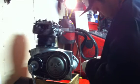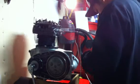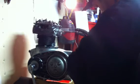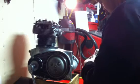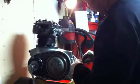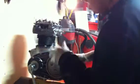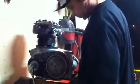Intake is 8 thousandths, or the exhaust was 10 thou. So get on this 8 thou. Make sure you have the right feeler gauge. If you use the ones that look like copper or brass and you try and throw them in there, they're gonna bend up real easy. This one's a little harder, a little sturdier. I got a lot to play with here, so I'm going to just snug these down with my hand.